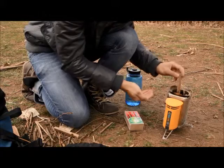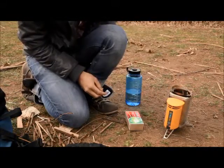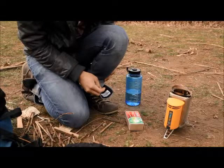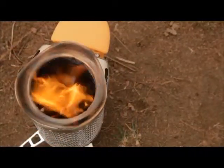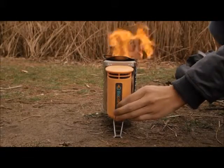If you don't have a fire lighter, you can also add small kindling or some paper to the top of the stove and light that with a match. Wait about 10 seconds and then push the power button to start the fan on low. This creates the flow of oxygen to the fire to help start it quickly. As the fire builds, you can push the power button again to set it to high.